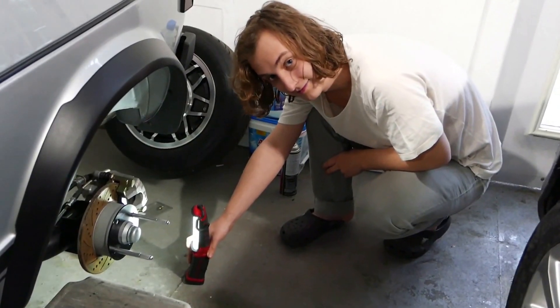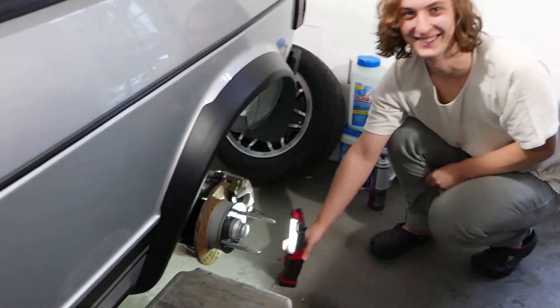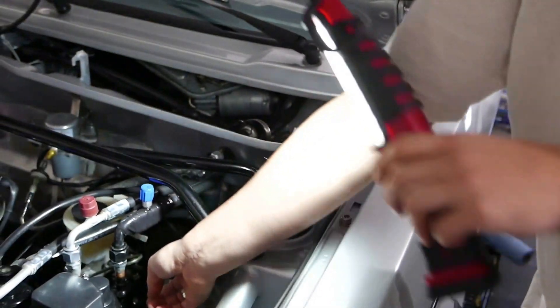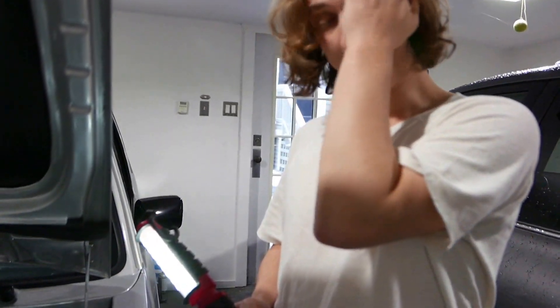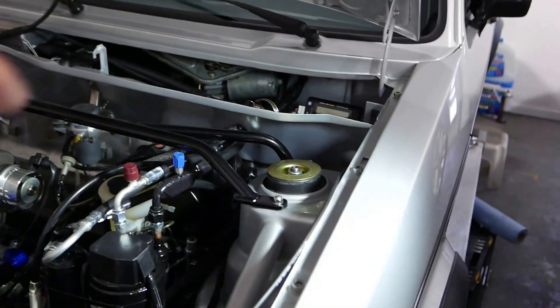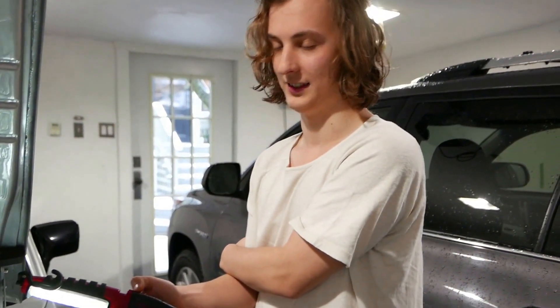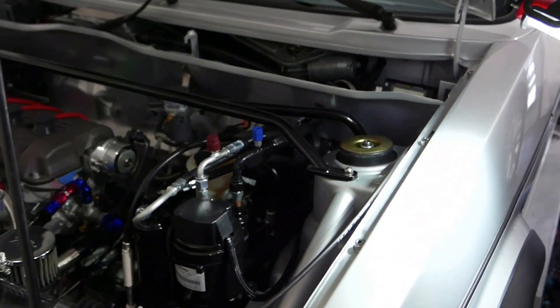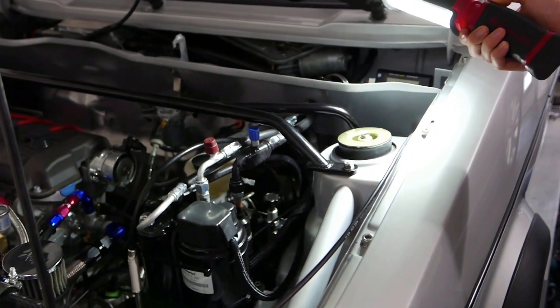Here's my braking assistant, Colin, my middle son — home for the holidays. I realized I had the proportioning valve turned the wrong way. What did we see? The maximum when it was all the way out was almost 1,400 psi — a bit less than 1,400. So when the proportioning valve was basically wide open, it let almost all the pressure through. And when we cranked it all the way down, we got 500 to 600 psi, which is the money shot. I think I just had the proportioning valve turned the wrong way when I was testing it.